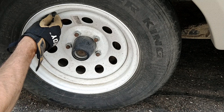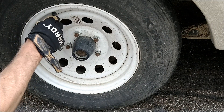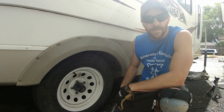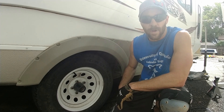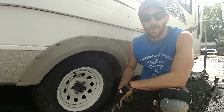Only one out of the four tires had a little less pressure — pretty good overall. That wraps it up for this quick RV maintenance tip video on rotating your tires. Follow your manufacturer's recommendations, but three to five thousand miles is a good rule of thumb.